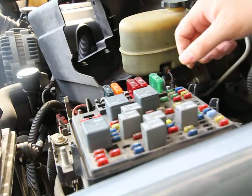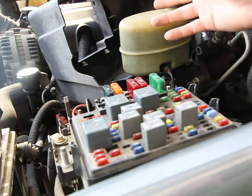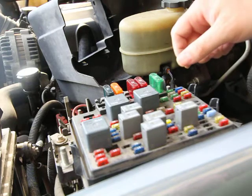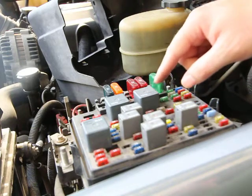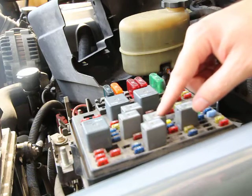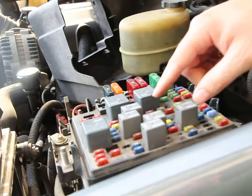Other than that, just reassemble the box and put your brace back in, and then obviously your switch — route your wiring, your ground, and install your fog lights, and that's pretty much it. This is really just to cover a more in-depth view of the actual inserting of the terminal into the front light pack kit harness, just so there's good clarification for the 99-02 guys that may have issues trying to decipher from the other videos since it wasn't very up close.